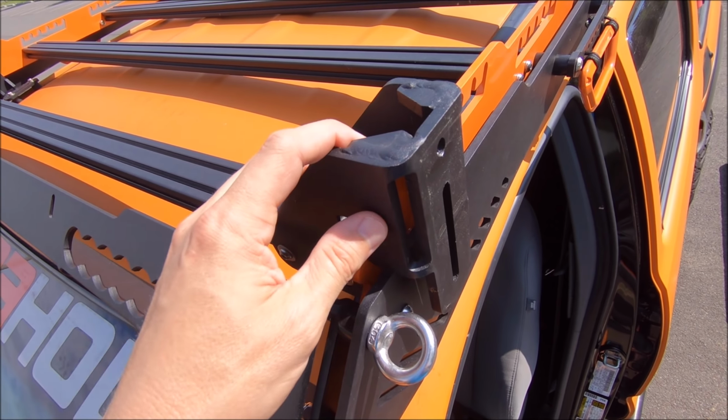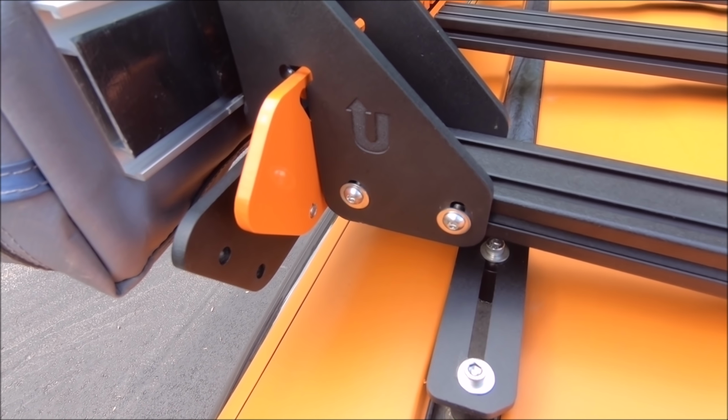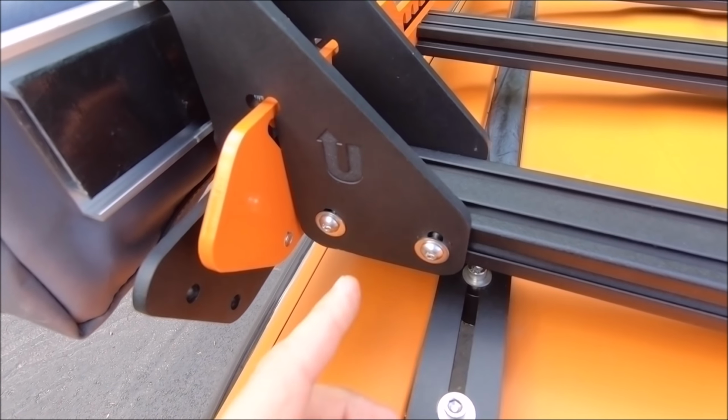Mine, you can hand tighten this. You don't have to worry about holding the back because obviously it's locked in the channel. Then just take your H4 bit and hand tighten that and you're good to go. Just two on each side and this thing is solid. And there's the ARB 1250 awning fully bolted down to the UpTop Overland awning mounts with a quick shot from behind for all the hardware. All stainless steel for the bolts, washers, and those little pieces on the inside.